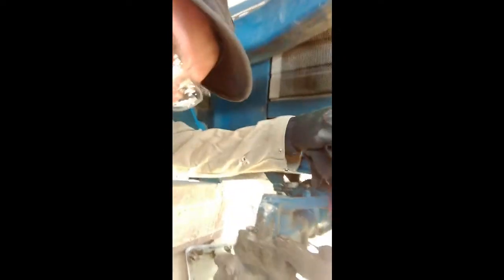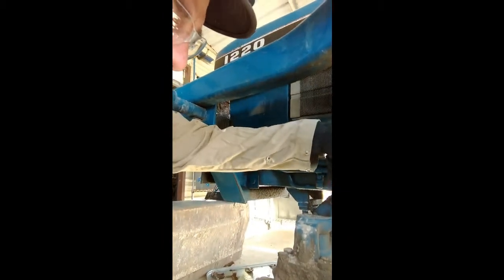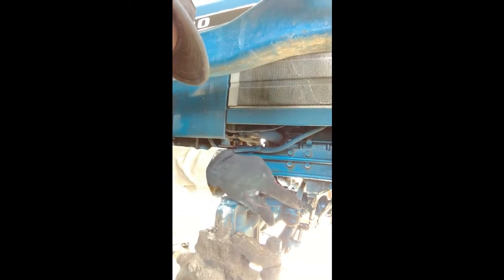This one I don't have the right puller for. I've got an older puller — this guy right here is the correct style, it's just not going to get up under there. What you don't want to do is damage this boot, so you don't want to use pickle forks or anything like that. You may be able to get away with loosening the bolt and cotter pin and banging it just right — it might pop right out. I tried loosening the nut and tapping it gently on the side with a hammer — didn't work. Off to O'Reilly's.